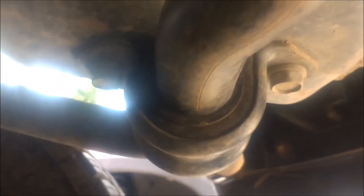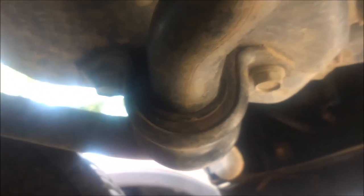Something else I'm going to do at the same time is put new bushings in my sway bar. Mine look like they're in okay shape, but it costs about $25 and I'm going to be in there anyway, so might as well. One thing you've got to do is measure the distance of these bars, as they're all different even for the same year truck. Get yourself a pair of calipers — mine comes out to about 1.3 inches, which will convert into a bushing size.